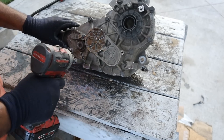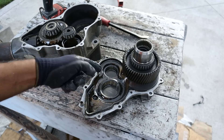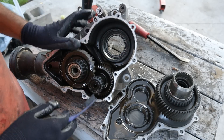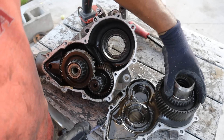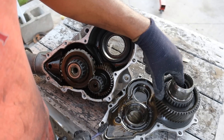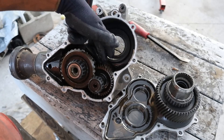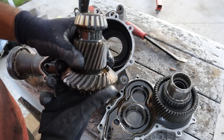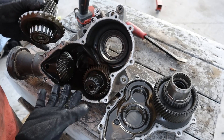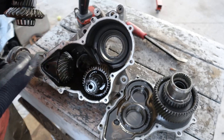I'm going to remove all these bolts. Looks like the gears are coming with it. I don't think someone was taking care of the fluid in this thing — it's a little dark. Now the all-wheel drive system in this vehicle is mostly mechanical. We have a center and a front differential kind of integrated into the final drive. The center differential is what's going to power this transfer case, while the front differential is going to power the axle, which actually goes through this housing over here to the right side wheel. As I remove this over here, we have a bevel gear on each side, similar to a differential in the rear of your car, and that's what's going to change the direction from transverse to longitudinal.